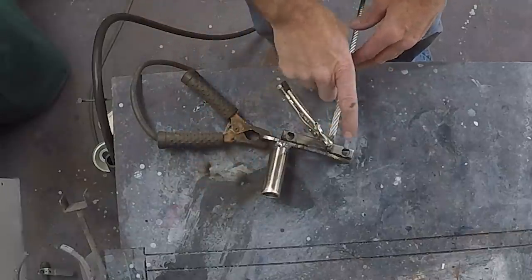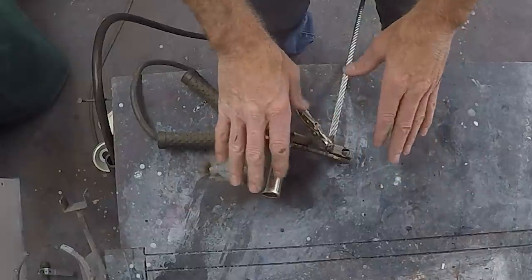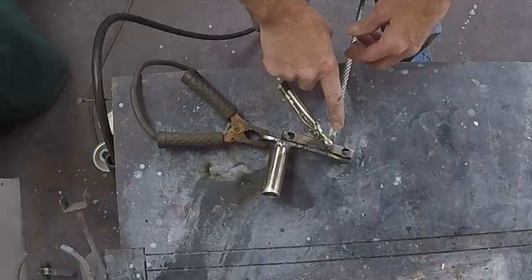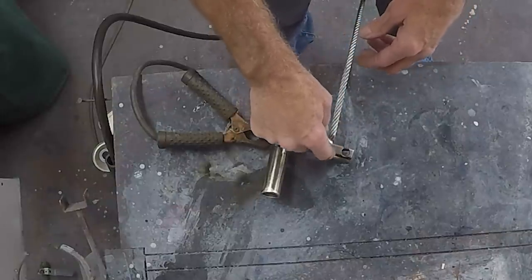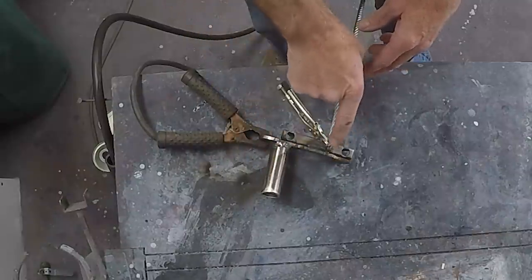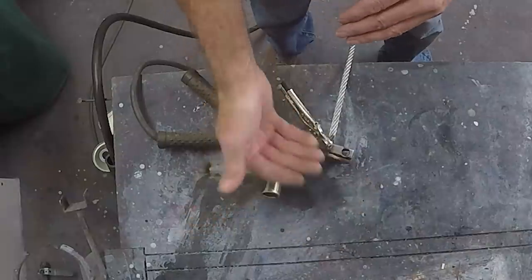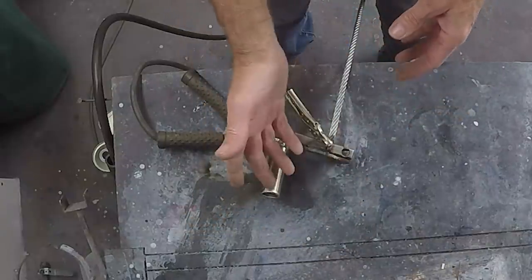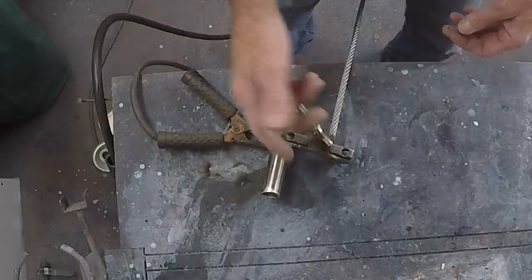And now, instead of trapping the cable underneath the clamp, which is going to kind of make it rock and hard to do, this is steel cable. It's just galvanized steel cable. So I already cut the end off and welded the end so it wouldn't fray when I was going to slip it underneath. But I decided to go ahead and weld it right to the back side of this clamp. So when it's up inside there, it's clamped and it's going to hold. It's just a deterrent. It's not like it's lifting or anything. So we're just going to weld that up real quick.